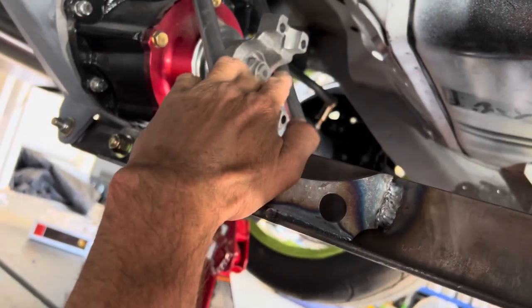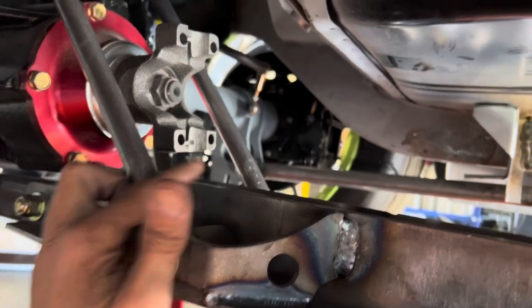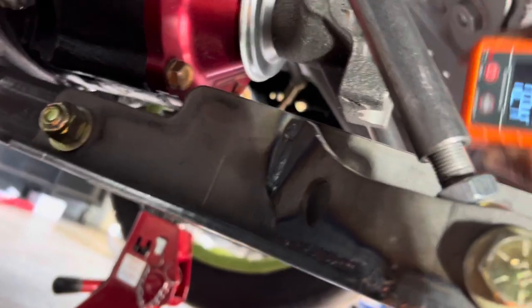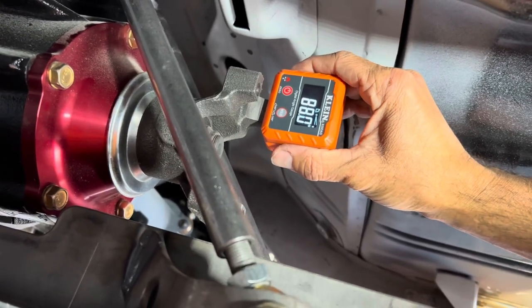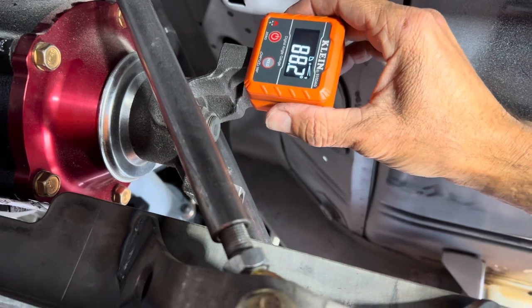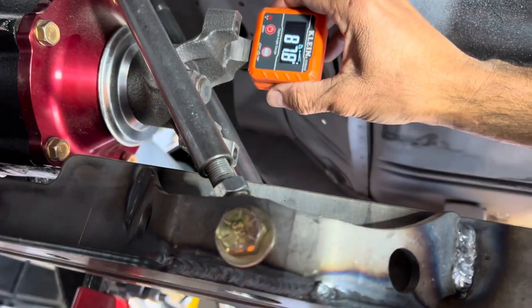This had to come way up. This yoke was almost touching the torque arm down here, originally the way I first had it installed. So I've been cranking on these adjustment bars to push the pinion back up. The only machined surface I really have is the front facing of this yoke. I can put this thing on here ten different times and get ten different readings, but it's all relatively close — about an 88 degree angle. Depending on where I place it: 88.3, 88.7, 88.5. So it's within about a half a degree of the front angle.